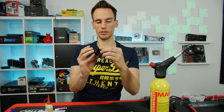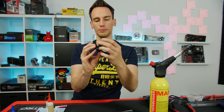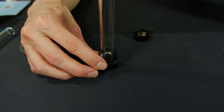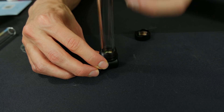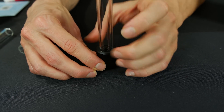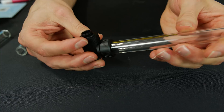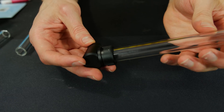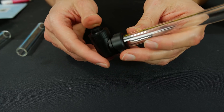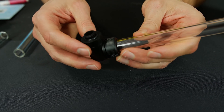Let's try to put this into one of those EK fittings. Now you also know what kind of fittings I'm going to use in this build - the new EK ones in black. Looks quite beautiful. It's extremely smooth. Putting the additional ring over the tube - yeah, this is pretty much perfect. I'm pretty sure we found the right method for chamfering or beveling the edges of the glass tube. But let's still try the other tools to see if we can improve our cutting.